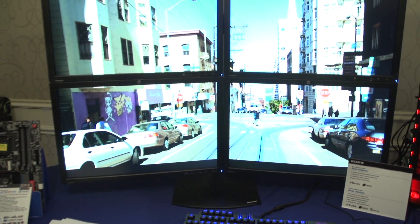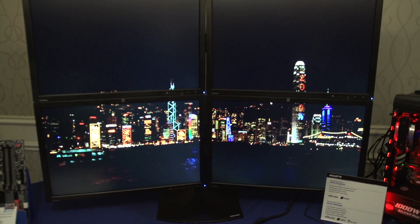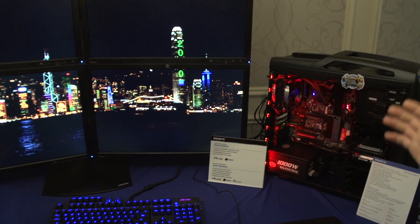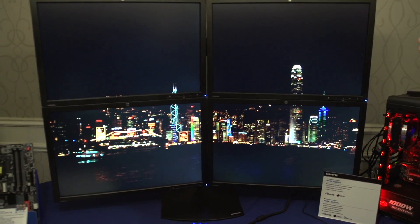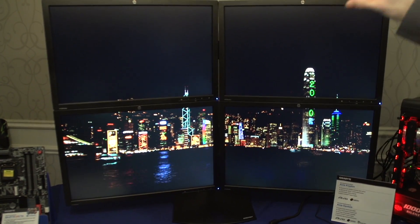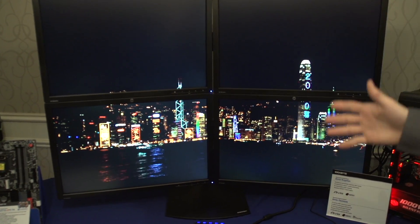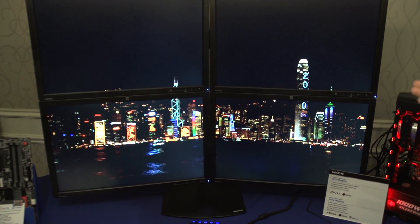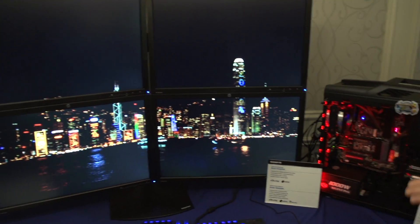This is native 4K content, and they're using a couple of adapters to take those mini Thunderbolt connectors — which carry a DisplayPort signal — and split them out to multiple DisplayPorts to achieve this huge resolution. The Ergotron stand and DisplayPort monitors are the solution because 4K displays are hard to get right now, but it proves what the platform is capable of in the near future.